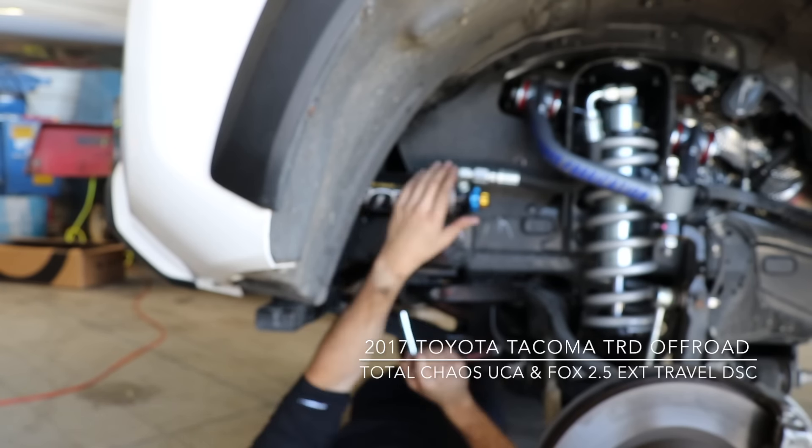Now that we got the wheel off the truck, we're going to go ahead and remove the covers starting with the front and the rear. You could use a flat head screwdriver and work your way around, or the dealerships have a special tool to remove these tiny little rivets. Since that was taking too long, I went ahead and used two pliers. Here's the rear flap. Store the front bump down below. Now your work area is exposed and we're going to go ahead and move the ABS wire loom out of the way.